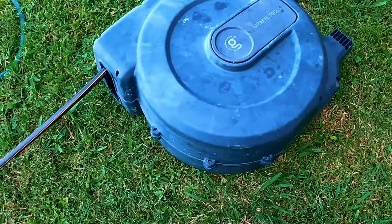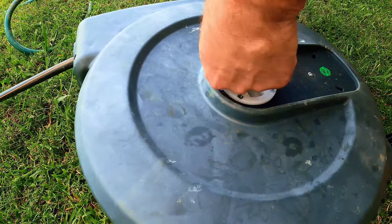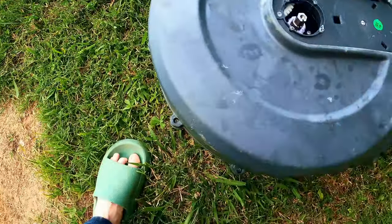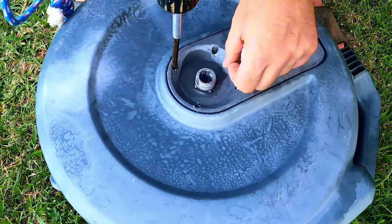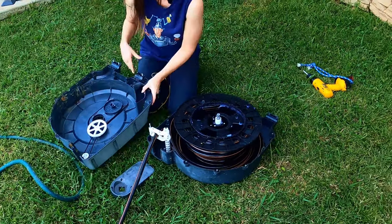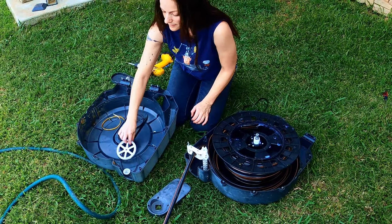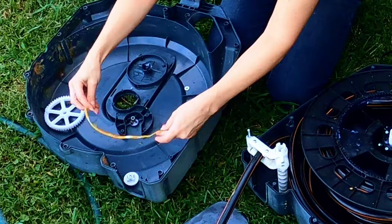You have to take both sides off, so you have to disconnect the hose on the other side. I am going to take the screws out all the way around. This is the side you need in order to get the belt off. The first thing you want to remember is don't pull the hose out the whole way because then you won't be able to retract it once you put it back together. There is a lot of grease in here, so just be mindful of that. This was the belt that was in here — all shredded up, not moving the mechanism.